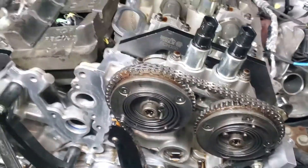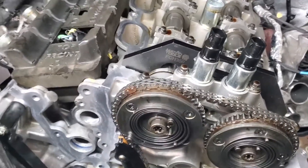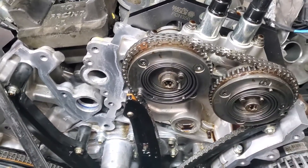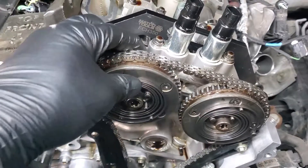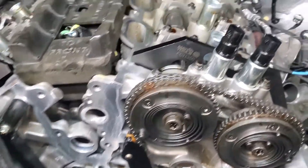So that's kind of what's going on inside the engine when you're hearing that rattle noise — it's this guy. The cool thing is they're superseded with updated phasers that are not exposed; it's kind of an internal thing and they just hold the oil pressure better.